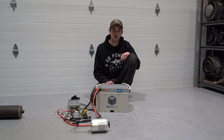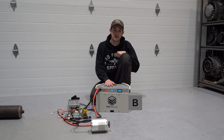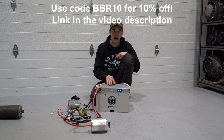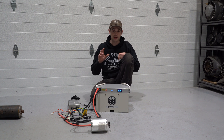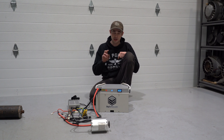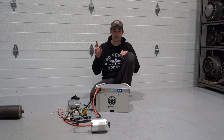The charger originally came with two 12-volt car batteries, so we obviously had to upgrade that. BigBattery.com was kind enough to send us this Falcon 72-volt, 28-amp-hour lithium-iron phosphate battery, which has two main advantages over lithium-ion and LiPo. These are very stable, so this thing has a 10-year warranty, and these are also very safe, so you're not going to have to worry about burning down your garage — making these perfect for golf carts, mini-bikes, and go-karts.